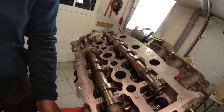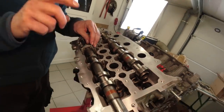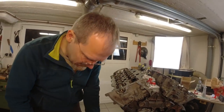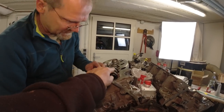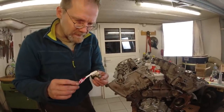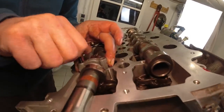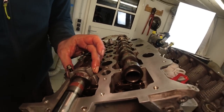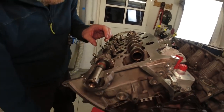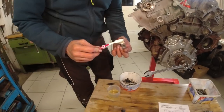But you're wrong again. Why? Because that line has to be tightened first. Mounting is not a problem. You can mount them, but tightening has to be that line first. These numbers on there do not really indicate in what orientation they go. They only indicate the place where they go. Yeah, but it makes sense that the arrow part goes to the inside, you know. Where is an arrow? Well, here. The tippy part. I would think that makes sense, if that engine's ever going to run again. No, it's going to run.